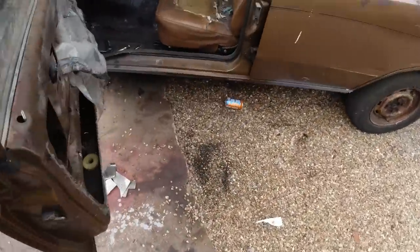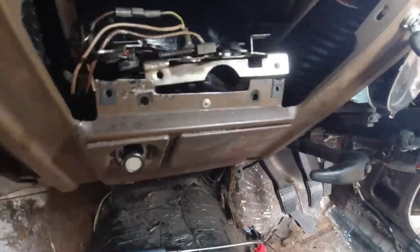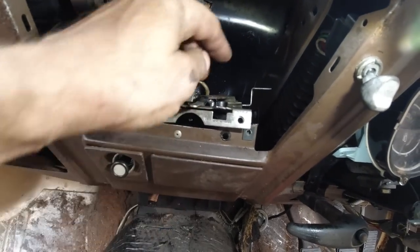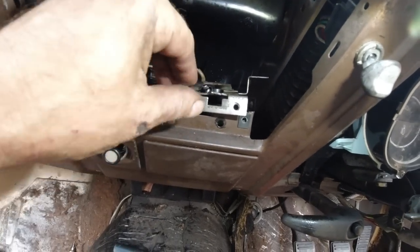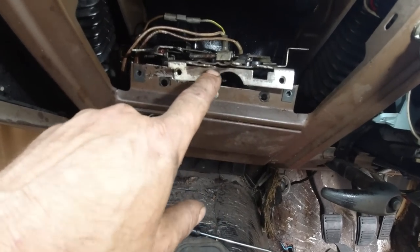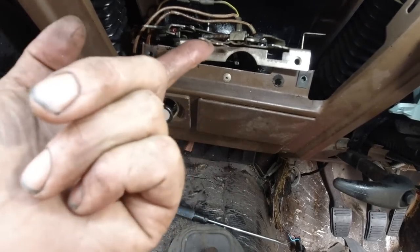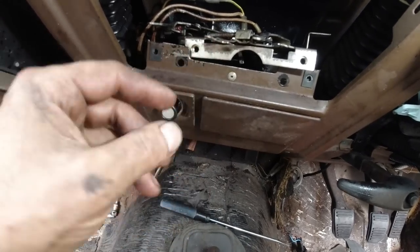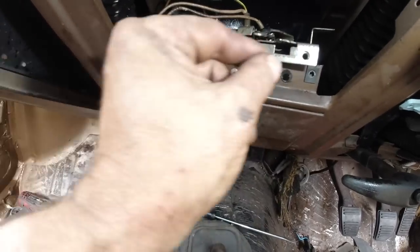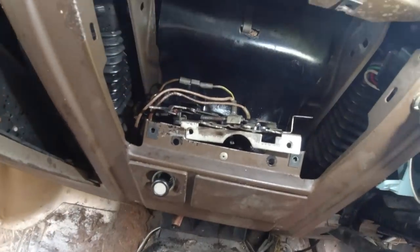And then you've got to go under, put the cables in, the lever, that operating lever. Remember, very early on in the series we got onto this. That's the lever that I've added. Pin at the back, little spacer washer. And I've also tightened up the ball bearing. You've got a ball bearing in this lever. It's sprung mounted from the back. There's a little finger spring on this tongue. Be careful you don't lose the ball bearing, but it makes it so that it clicks in positions. And you might find yours has gone a bit loose. You can tune it all up there like that, okay?